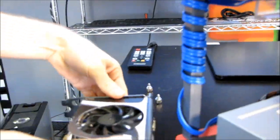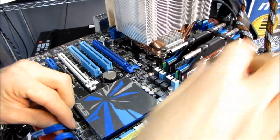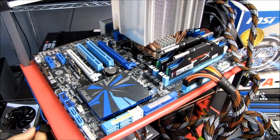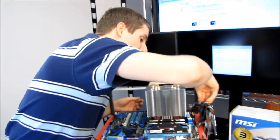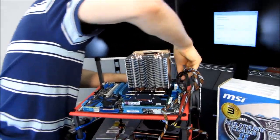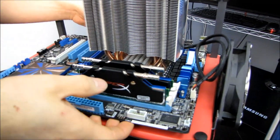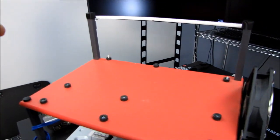I'm taking off my graphics card here. You can see the motherboard I was using before was an ASUS P7 P55DE Premium — that is a P55 board. I've been questioned a lot about my use of a P55 board even in dual graphics card testing, and I can tell you with confidence that in my experience dual 8x graphics slots does not adversely affect performance versus using two 16x slots.